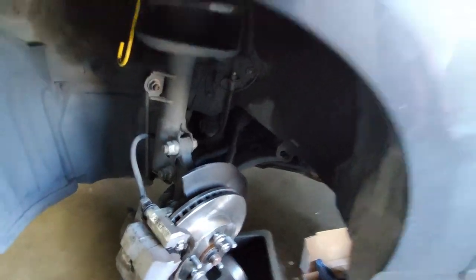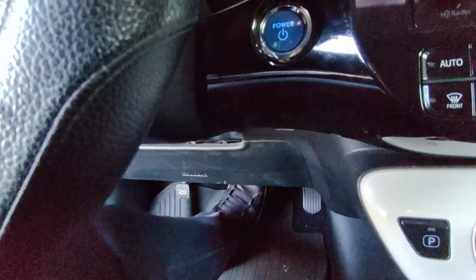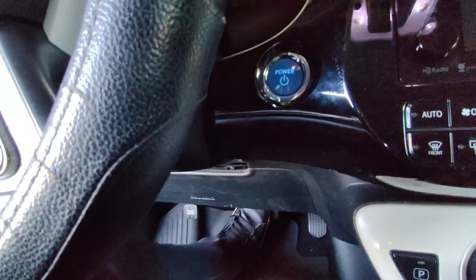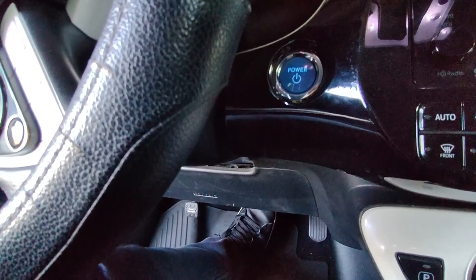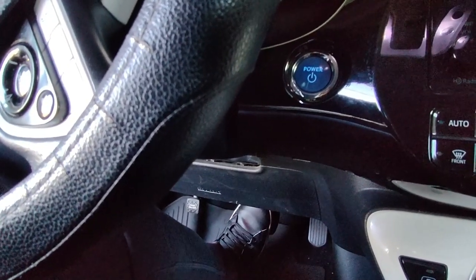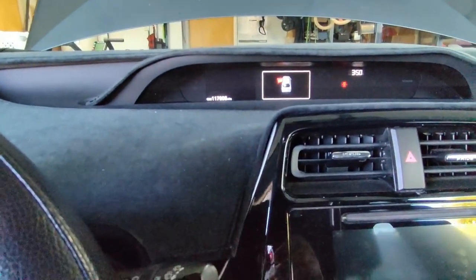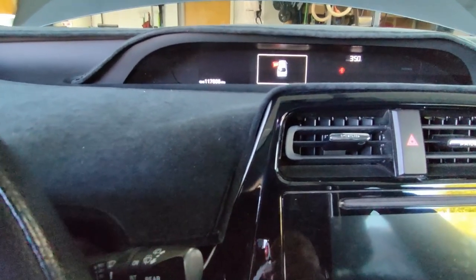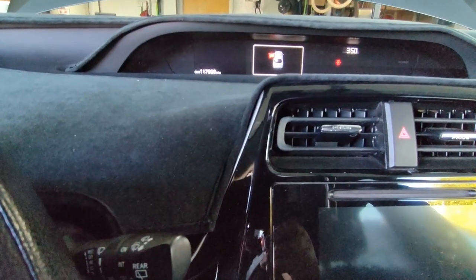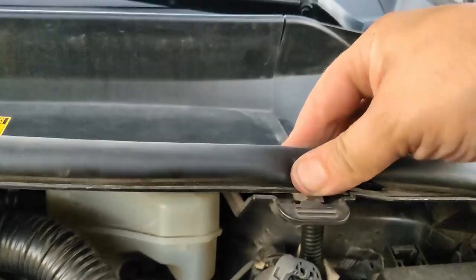With both the driver and passenger side brakes done, go inside the car and push the brake pedal nice and smooth a couple of times. Only do this when the calipers are completely assembled — pumping the pedal without the caliper on will push the piston right out, and then you'll have to bleed the brake system. On this Toyota Prius, ABS bleeding requires a scan tool. My brake fluid looks good — I've tested it with a tester — but comment below if you want a video on that. Make sure you put the cap back on the brake fluid reservoir nice and tight.